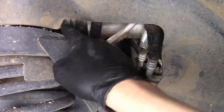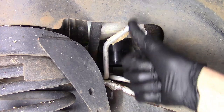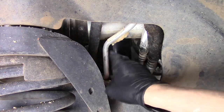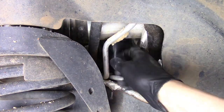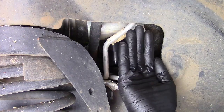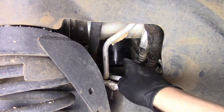Here's that opening inside the fender well liner so that you can get to that oil filter if you're going this way instead of from up top. Now your clearance is a little tight. These hoses do flex a little bit. So as you're coming through it's not just going to easily come out — you may have to manipulate it to come out. But once you come out you've got to go from being straight up to turning it and coming out, and that's where you have the tendency to spill the oil.